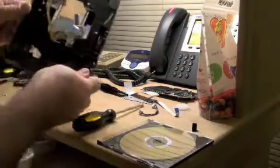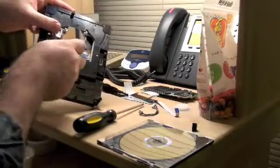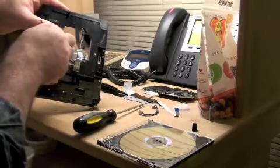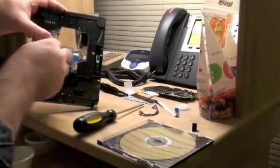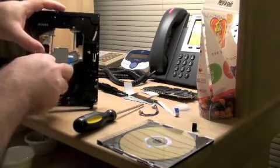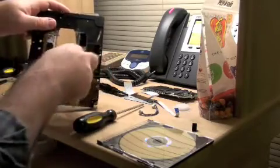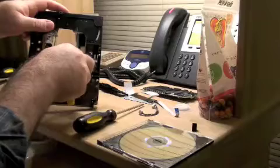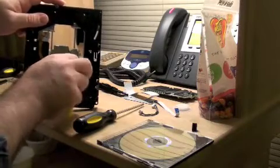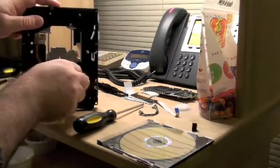Loosely. On the back, you've got to thread your stepper motor ribbon cable. It's not important at this point to make sure that it's routed properly — you'll have a chance to do that before you close it. Make sure that the spindle motor cable is properly routed.